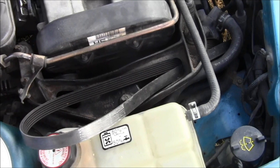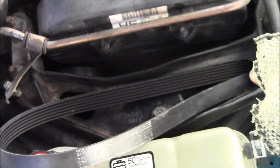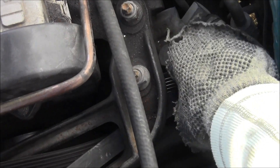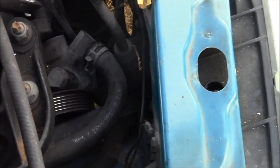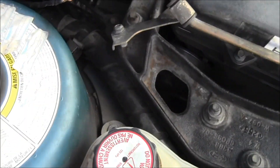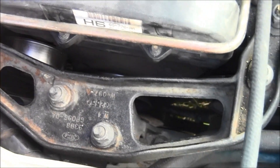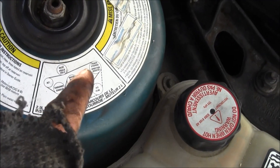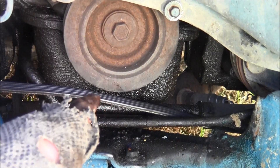That's how you remove it. There are various ways to install this but a little trial and error won't hurt. I'm just snaking it all down in there - this part goes over top of that part, that's what the diagram shows, over top of the power steering. I'm going to go from below because that's where it came off. It goes over the alternator, underneath the idler, then over the power steering, underneath the AC, underneath the crankshaft, and this model does a loop-de-loop around the water pump and then underneath the tensioner.